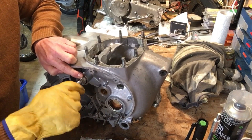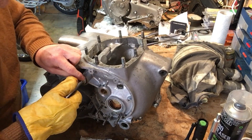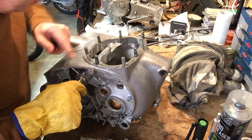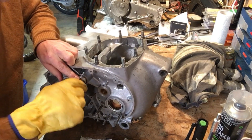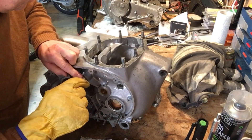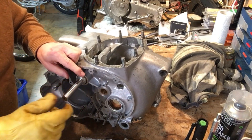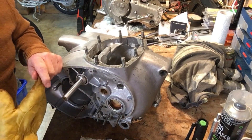So I'm going to continue to do this — it might take a little while — and gradually go a little deeper in. We're probably not far off two-thirds of the way through the bush now, and we know it's towards the lower end of that bush where when putting the cases together the cam really tightens up. So I'll keep going with this and bring you back when I think we're completed, just taking it patiently.